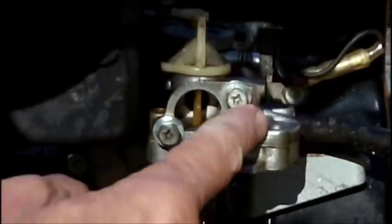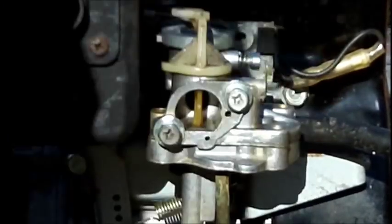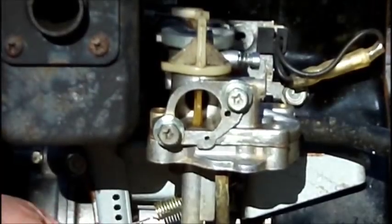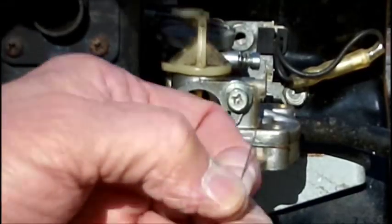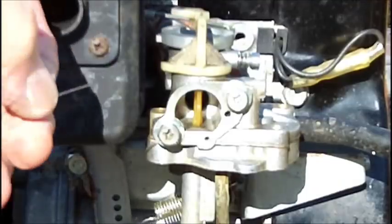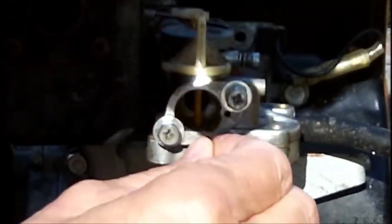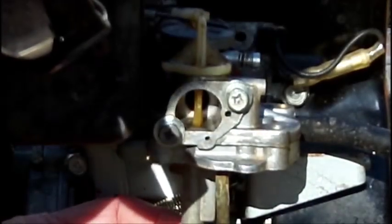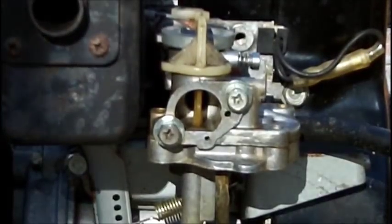So now I hope there isn't a diaphragm in this, because you would never be able to get a diaphragm for it, no way. So the only thing I can hope for, and I'm not gonna put it together today, is to find out from somebody what size wire would I go up in here? I mean, this needle here is real, real thin. It's one of the smallest, thinnest needles that I've ever seen. And it goes right in that little hole, no problem. But it won't go up the tube, up the jet. And I'm not going to risk busting the jet off.